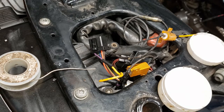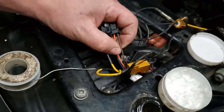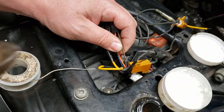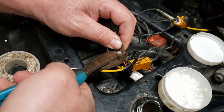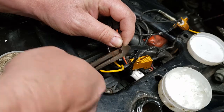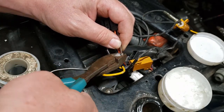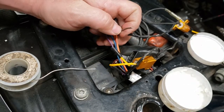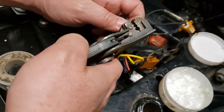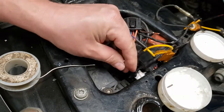Let's get to it. I already looked through the wiring diagram here, so it's the purple wire and the brown wire that go to my turn signals. You don't do this on all four — you just got to put one for your left side and one for your right side in your system, and it'll work. So we're going to cut into the brown wire here. I would guess it's probably purple and brown on most Harleys because Harley does love to standardize things, but you should check with your service manual before you confirm that.